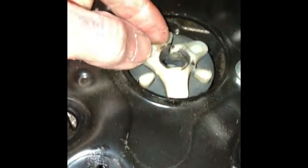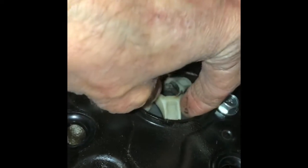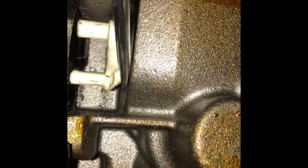Get it out of the way, and right here we can see our broken motor coupler — this plastic piece broke. We need to pull out the old one. The new ones are slightly better; they have some metal built in. The reason these break is old age or when the washing machine is asked to wash something very heavy like a blanket or bathroom mats. I'm going to come underneath here, get a screwdriver underneath, and pry it off. There we go, it's off.